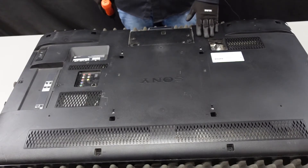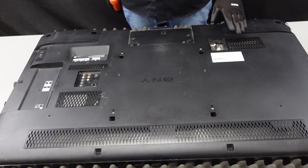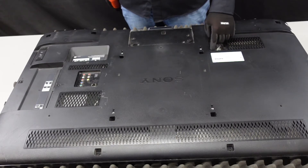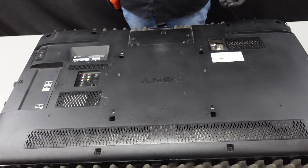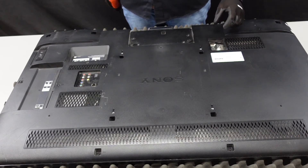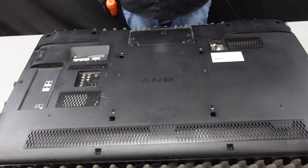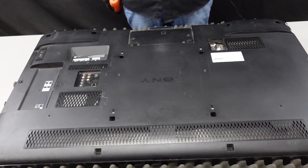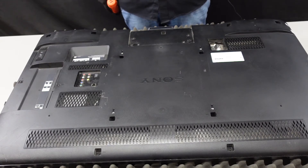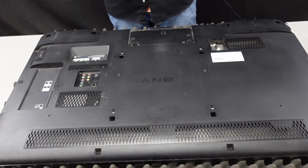This is the back of the Sony unit. We are going to be getting all of these screws out of here. One thing to keep in mind: it's going to be a little bit different with your model at home. There is going to be a plastic plate with one screw in it that is connected to the power supply board, and that is going to need to be the first thing you remove. Take this screw out, pull the plate up and away from the back, reach in and unplug that plug from the power supply board, which should allow you to pull the back up and away from the chassis. There are quite a few different kinds of screws here, so keep them separate so you know what goes where.